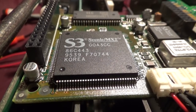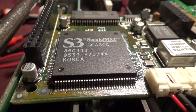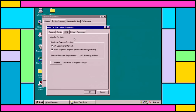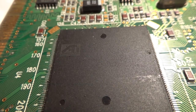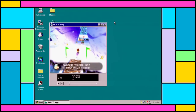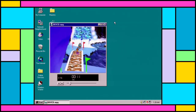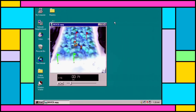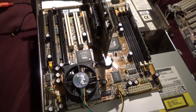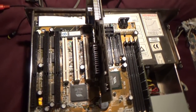That and the MVP 1100 MPEG accelerator won't work here. I think the WinTV might be the cause, as it had its own MPEG card option, and the bit for that add-on is being flipped by the Diamond drivers somehow, it seems, so who really knows? As there's no real advantage to using the Verge here, and the ATI acceleration, whilst less powerful, did work just fine, as this thing's actually nearly fast enough to decode such things in software anyway, so a little bit of assistance is enough, I probably will go back to the Mach 64 soon, because I'd like to have an ATI running, and my new K6 is probably going to be using an Nvidia card, while the Pentium 2 would use a Matrox if I could ever finish it.